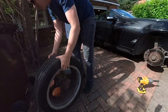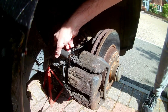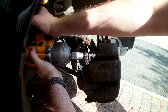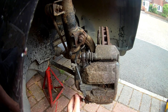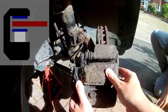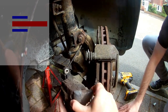The next step is to undo the bolts on the calipers. These were very rusty on my car, so I sprayed them with WD-40 before starting and gave it a few minutes to soak in. I then turned the steering wheel to make it easier to access the bolts at the rear of the caliper, although this was only really necessary because we were using the impact driver. We were then able to undo them with a 12mm socket. These bolts should also be completely removed. Now the caliper can be slid out, although you might find it needs a bit of a wiggle to get it moving. When you're doing the front right brake, make sure you unplug the wear sensor from the caliper before you remove it, or you'll break it, just like I did.